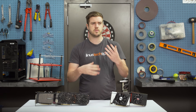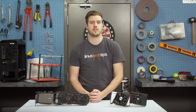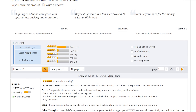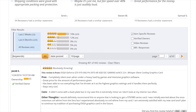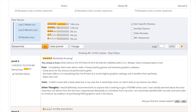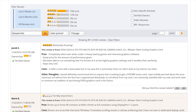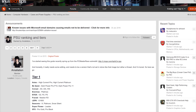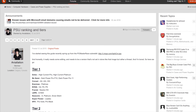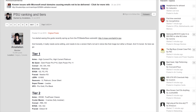But if you'll be running more graphics cards, like two or three, you might need to look into something more. Check out reviews to see how much your card actually needs — sometimes power requirements on spec sheets are vastly overestimated. So don't be too disheartened if you only have something like a 450-watt power supply, as it may end up working just fine, as long as it's a good one. There's a great thread on the Linus Tech Tips forum that covers which makes and models are considered good — check that out via the link in the description.